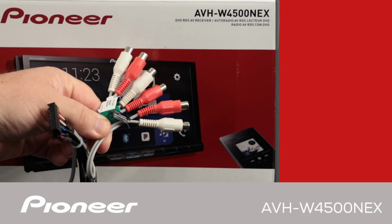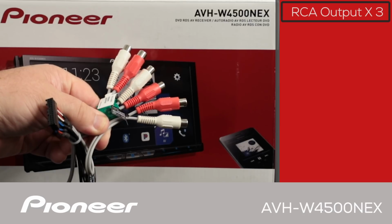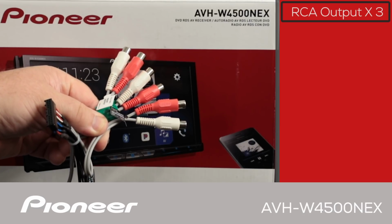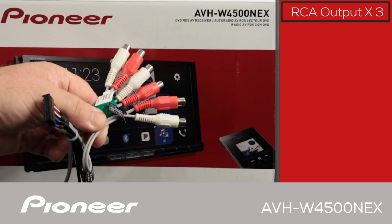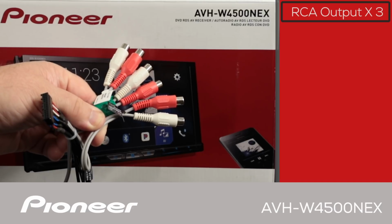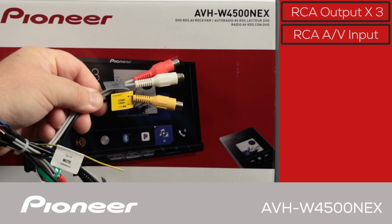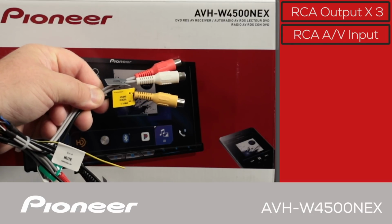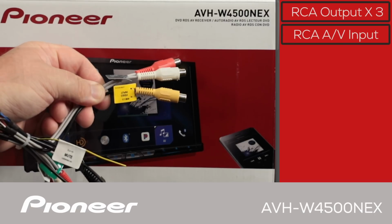On the signal input-output wire harness, we'll start off with three sets of 4-volt RCA outputs for operating external amplifiers. They can be set up as front, rear, and subwoofer output, or for higher audio quality and better system control, high, mid, and low output. Next, we have an audio and video RCA input. This can also be used as a second camera input.